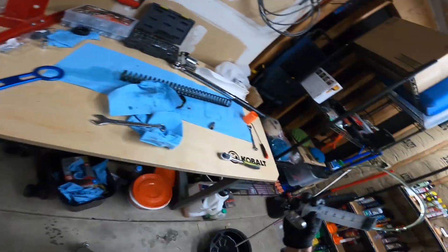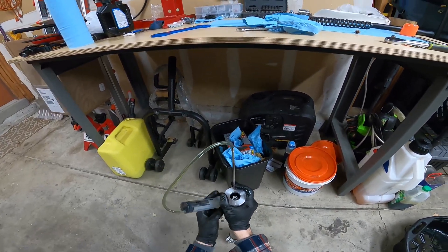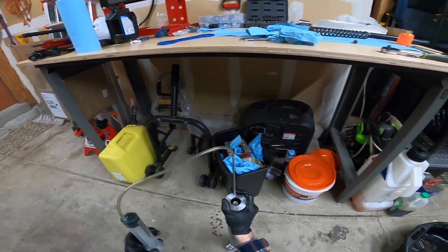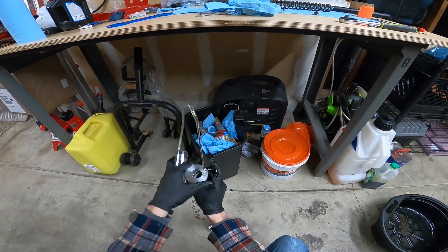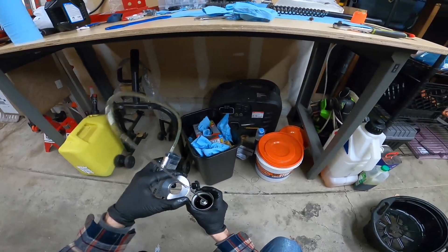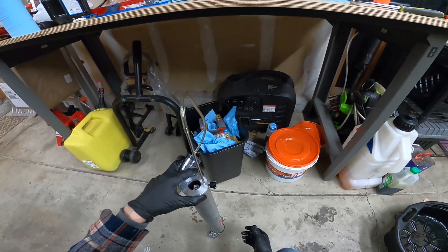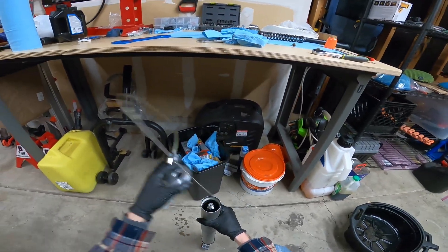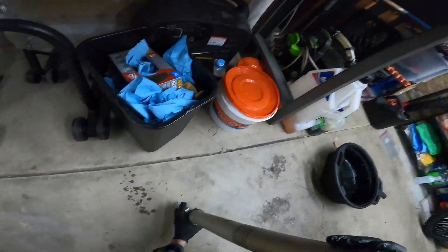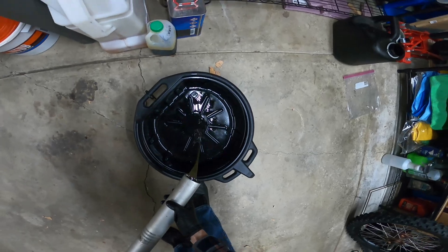Out of curiosity, this is set at 340 — actually it should not suck anything. They set these at about 130 millimeters down. I said 340 — I meant 130 millimeters. That's what I set my other fork to. Put a little more oil in it to make it a little less plush. Anyway, it's probably about the same in this one — it's over 130. So we pour this out; my other stuff was kind of junky, but that's not as bad.